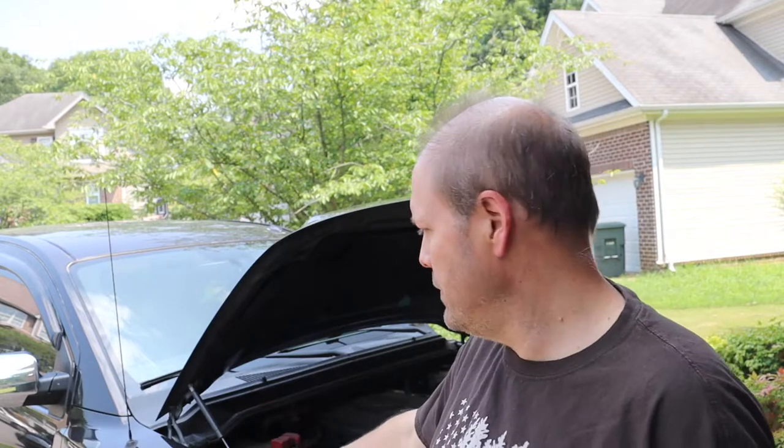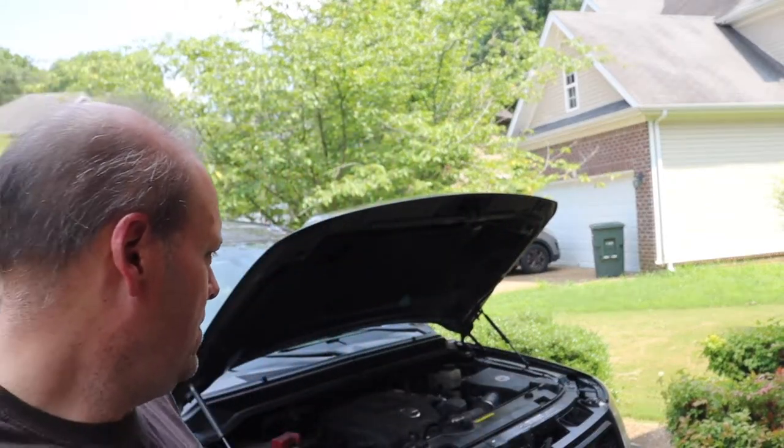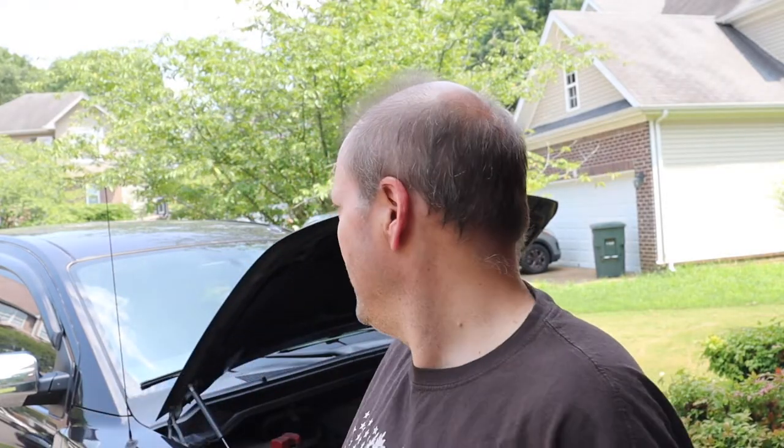We're going to wrap up. These are some pro tips on what I do with my truck. If I were servicing it myself, it would get synthetic oil every time, changed per the vehicle manufacturer. They're saying now that a lot of vehicles can go seven to ten thousand miles between oil changes, but I still don't believe that. I go five thousand on synthetic. If you're not using synthetic, I go every three thousand — that's just how I was trained. I will not run a vehicle past what they suggest, and I'll change oil early before it goes over its mileage.